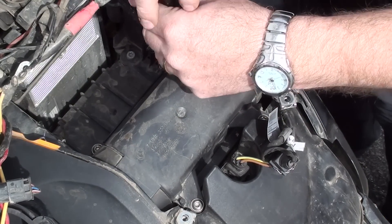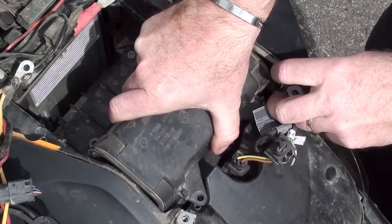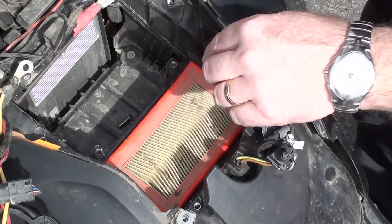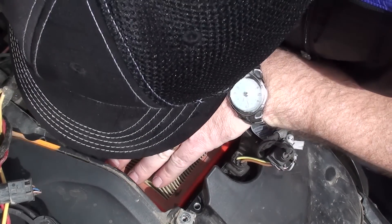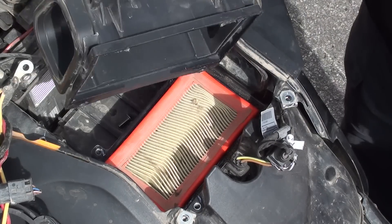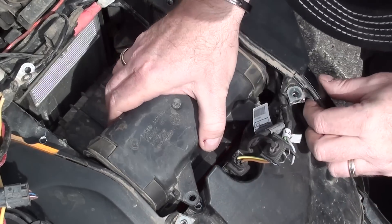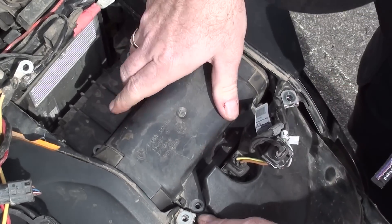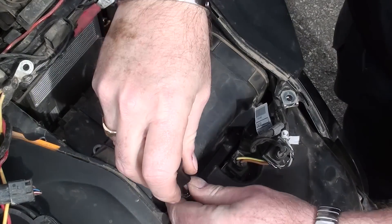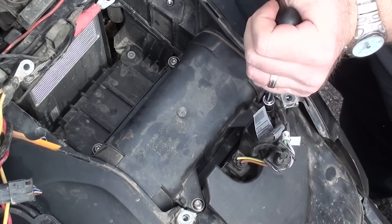While you're in here with the T30 on the end of the wrench, why not pop off the air filter and take a look? This is the old style F800 air filter — the new ones have a mesh screen on the top. It was in there nice and tight; it was a little dirty but not worth changing, at least for me. Pop the cover back on and replace the four airbox screws.